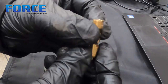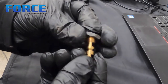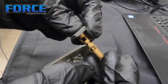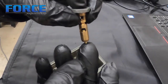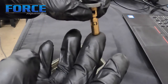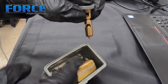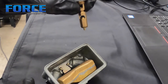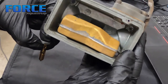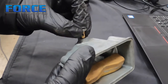You see the two flats on there for the nut. This is how the needle and seat works — there's the needle, the seat obviously being up in there. It uses fuel pressure to push this open, and as the float rises it closes this valve. So it regulates the fuel inlet to keep the float level correct, to keep the pressure in the bowl where you want it. Obviously, with no needle and seat in the thing, the float goes all the way to the top.